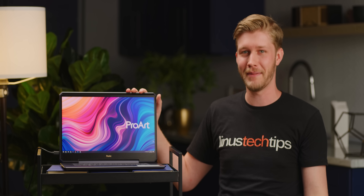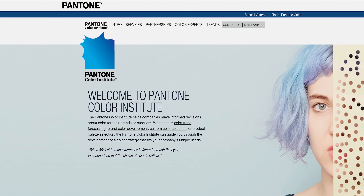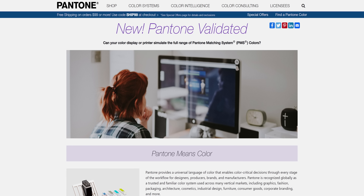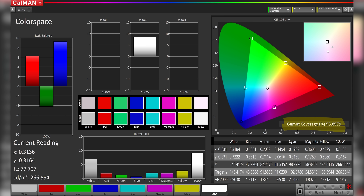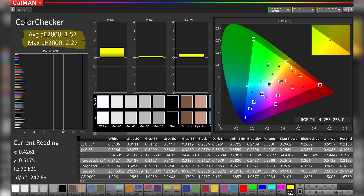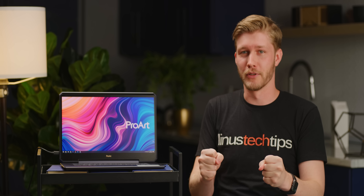Now, yes, it has more bezels than you can shake a stick at, but it comes pre-calibrated to cover 100% of the Adobe RGB color gamut with Delta E's of less than one — that's no easy mark to hit. Additionally, and this is important, it's Pantone validated, meaning Asus went out of their way to get the panel certified by an industry-leading third party, so your screen is color perfect right out of the box. Our testing slightly missed the mark with 98.8% coverage of the Adobe RGB color space and a Delta E of about 1.5. Before you get your knickers in a twist though, this is still an amazing result, more than good enough for color-accurate work. And this machine is pre-production, so it'll hopefully be improved by the final units.